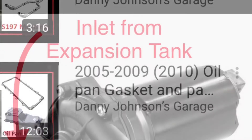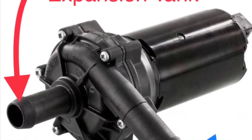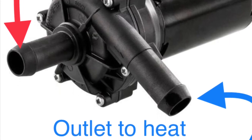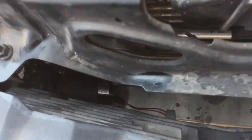He was having a problem with the intercooler pump. On the intercooler pump, the front inlet coming from the expansion tank goes right there into the nose of the pump. It gets swirled around and then it gets spit out the side of the pump. I wanted to make sure that was set up properly, and it was — we can hear the pump trying.